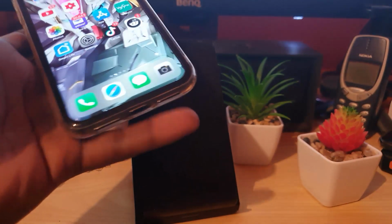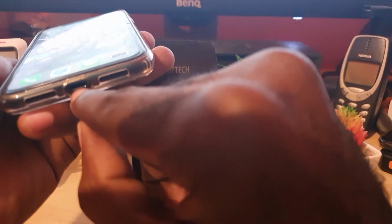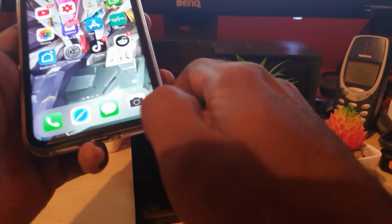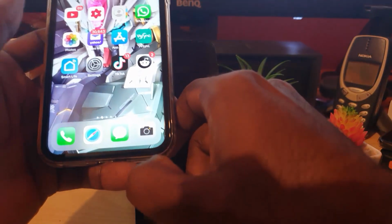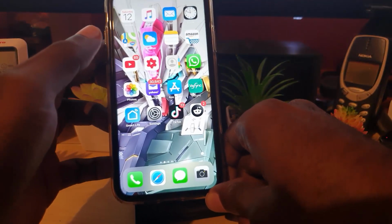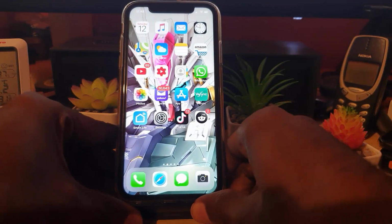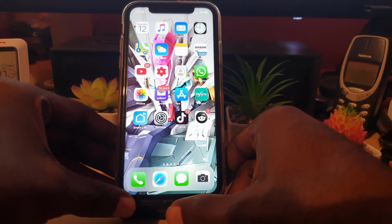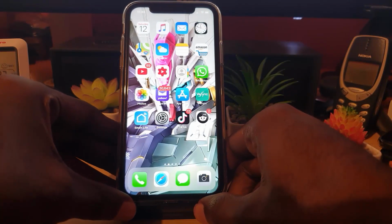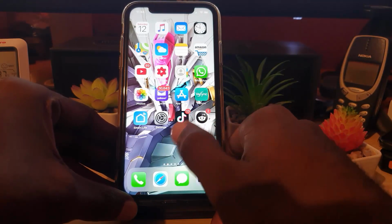And of course, finally, guys, if for some reason you have done especially the rice, and you have made sure that the port is dry, there's no moisture in the port, and you're still getting the error on screen when you plug it in, if you're very sure that there's no water, and remember, you're doing this at your own risk, you can go ahead and use the override feature. But only use it if you're absolutely sure that you have taken all of the precautions and dried the port completely. Once there's no moisture, in case it's just a hardware error, it should start charging.